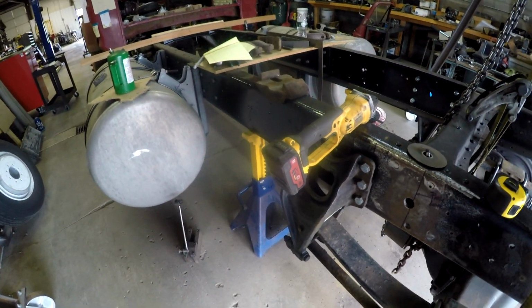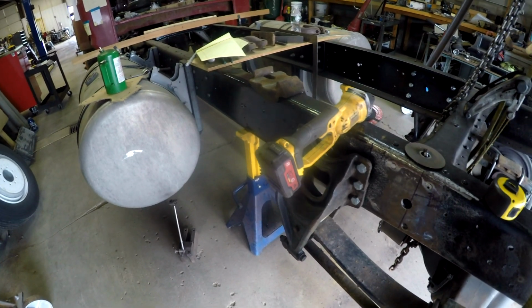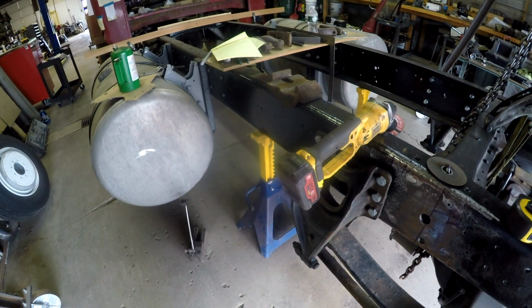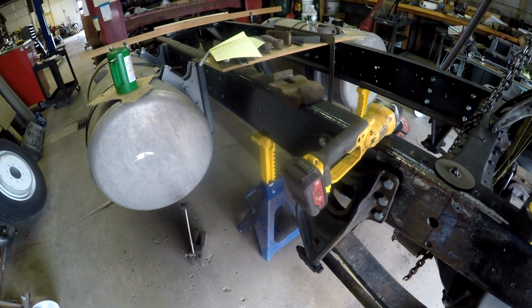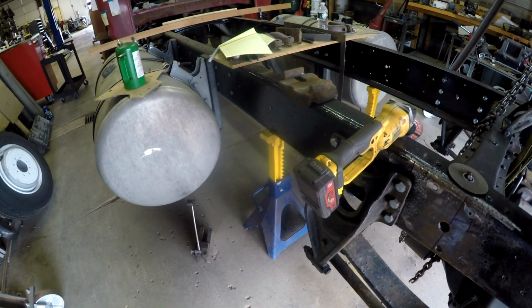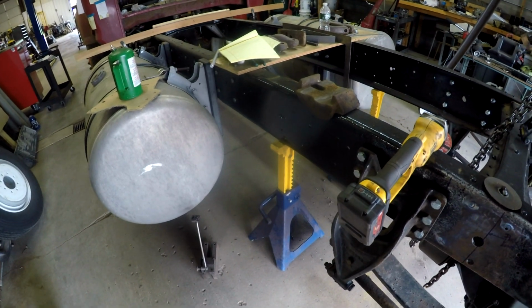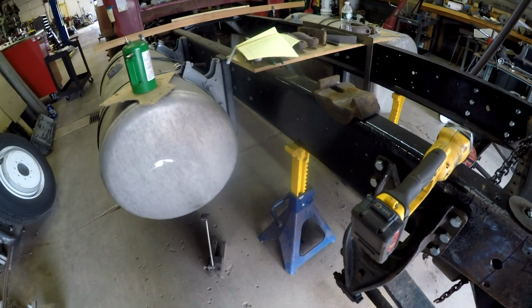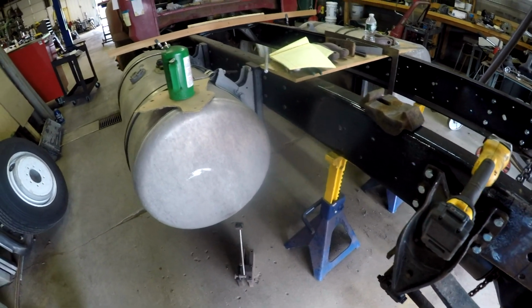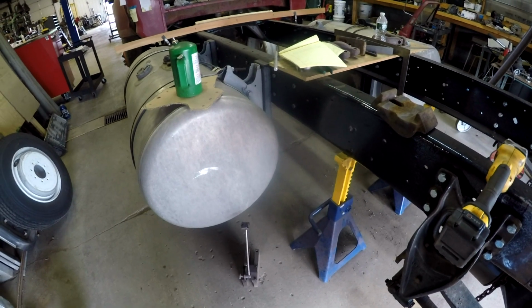Okay, last chapter, chapter 57 of the haul truck, you saw the issue that I had with the brake caliper. Let's start this chapter out with me tearing it back apart and getting preparation for milling out the other side, getting the U-bolts cut, put back together in preparation for seeing if I can rotate that caliper around to the other position.